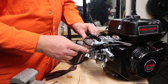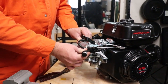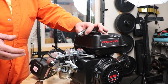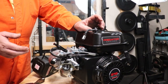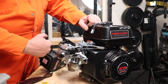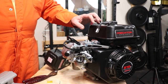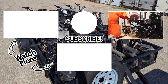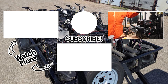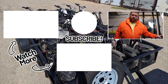As we're installing this kit into the mini bike and putting the air filter adapter on, you'll rotate this around and put it in the place that you want it and kind of keep it out of the way. So that is the filter kit install. This is the vent for the fuel tank — this allows pressure and air from the tank to come out. And this allows pressure and air from the crankcase and valve cover to come out also. So that completes the install of those. At this point, we've got the upgraded carburetor jet installed, the filter kit installed, and the exhaust removed. We are ready to put the clutch on and situate the new engine in the frame of the MonsterMoto 80 so that we can see where we're going to drill the holes. That's coming up.